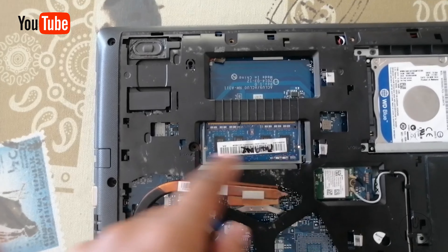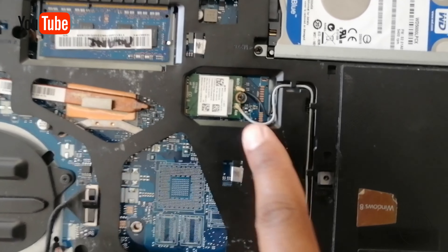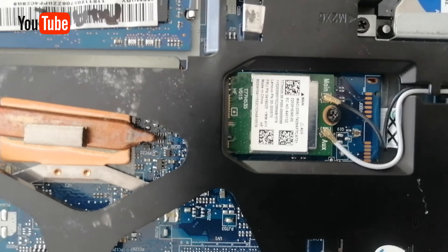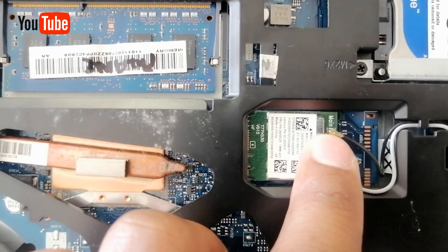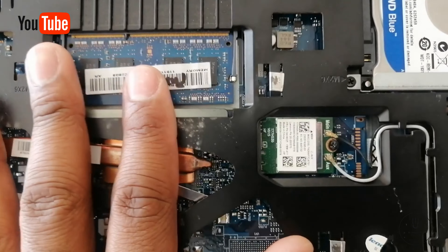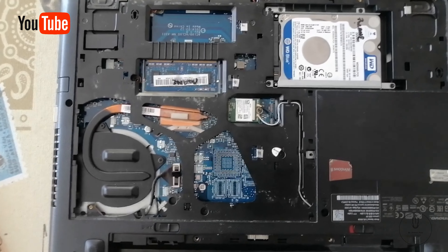Let's try and close it a bit. Here we have the RAM — you know what a RAM is — and the disk drive. Now, the cables that I was referring to come from the top part of the laptop to right here at the small component. As you can see, one is labelled 'aux' and right here it stipulates 'main.' They need to be connected in order for this whole laptop to be able to work.